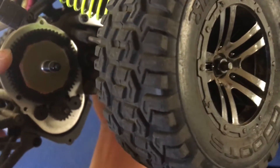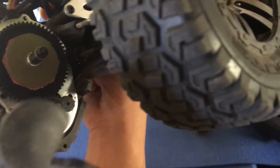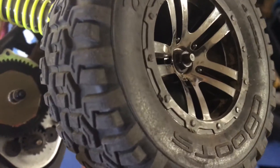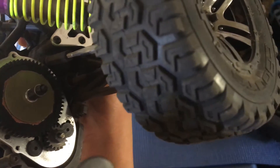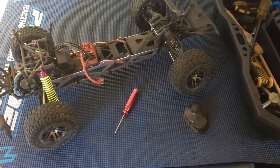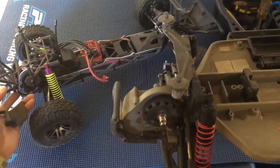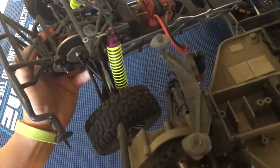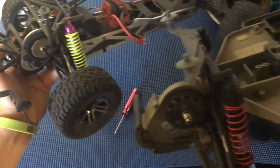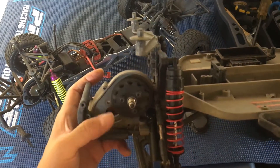Taking a look here — yeah, that gear mesh is really tight. I had put in a piece of paper to adjust the gear mesh, which is the usual method. These are 32-pitch gears, which are a lot beefier than the 48-pitch gears that come on the Slash. You can see the teeth on the Slash gears are a lot finer, while the Arrma Fury's are much beefier.